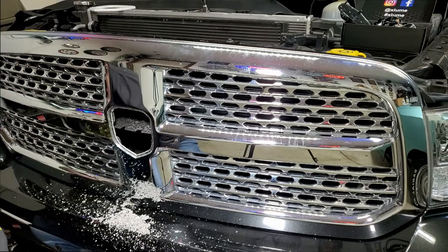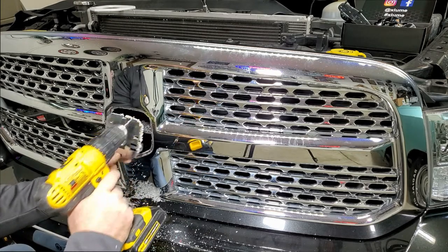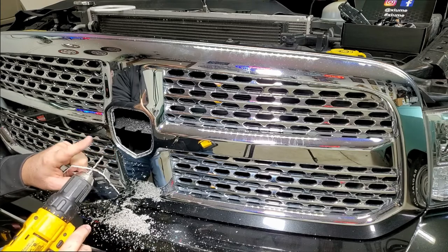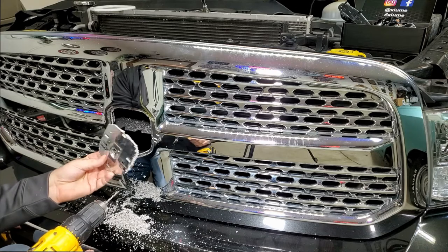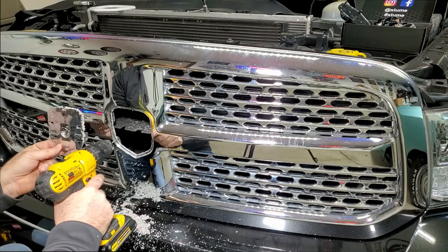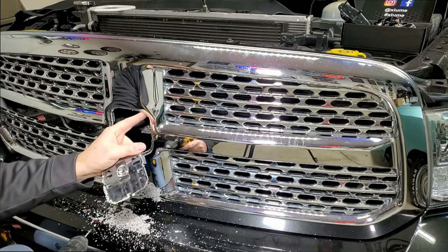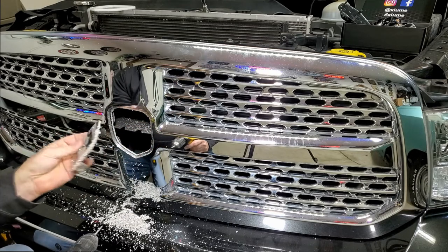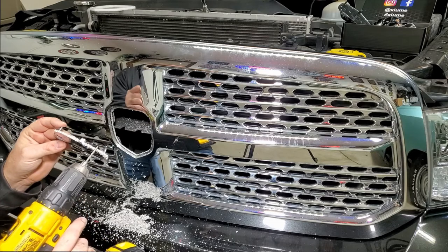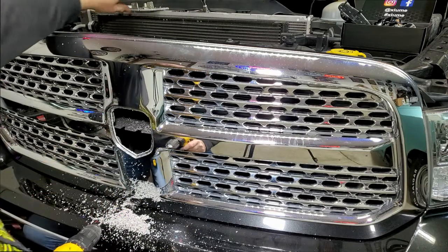This piece is going to be in there and you're going to take a drill with a normal auger bit and go around connecting those holes. I recommend pushing that bit all the way into the drill to get the least amount of flex so you don't have it snapping and going into your eye. Go through where all those holes are drilled, spin it up top, and basically connect all those around. This is a Laramie edition, so I have these grates in my grill that extend in on both edges. You'll feel them when you drill — don't try to drill through right away, just pull the bit out a little. You're just trying to penetrate the plastic, then connect all those together and cut that rough piece out.